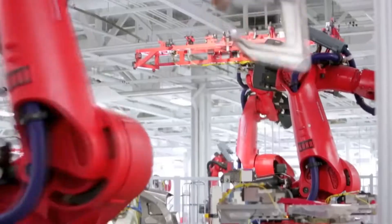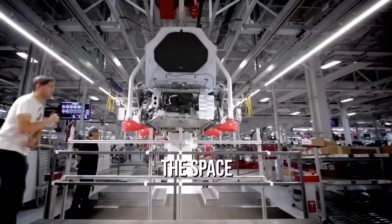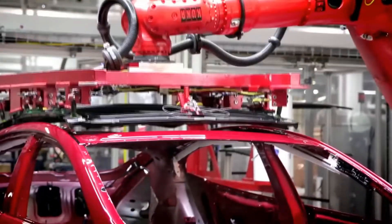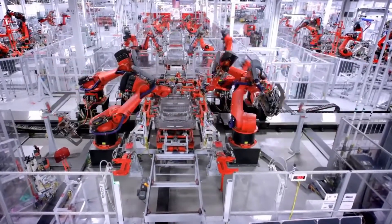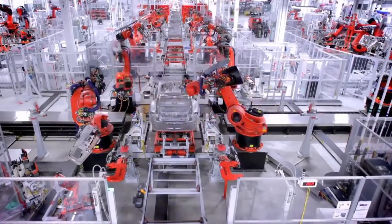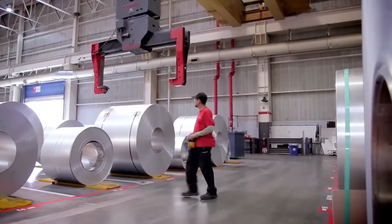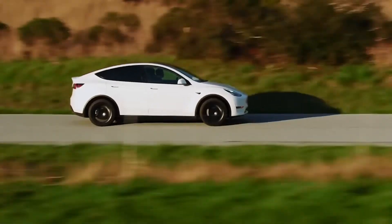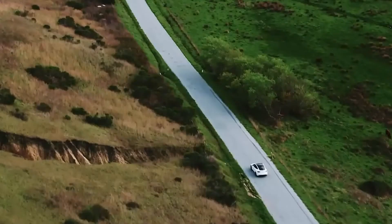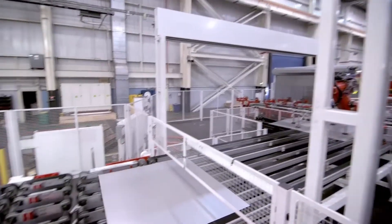The interesting process starts from the first stage. In the first stage, the skeleton of the car, technically known as the space frame, is prepared. This is done at a body shop. At least five robotic arms are put to work to fit various parts of the skeleton. This process is referred to as a sub-assembly. The skeleton is made up of aluminium, which makes it light and strong. The weight of a car impacts its performance, speed, and fuel consumption. The usage of aluminium therefore plays a very important role in making an electric car efficient.